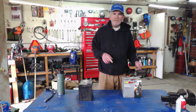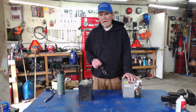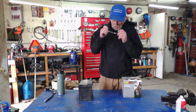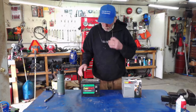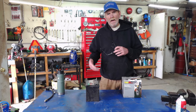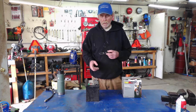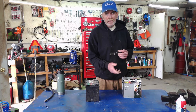Welcome back to the channel. My name is Eric. We do weekday Monday through Friday and that's available on podcast as well. We try to do some educational videos like we're doing today. Today we're going to talk about batteries, and the thing you have to keep in mind is the cold cranking amps. You need to know what your lawnmower takes to get adequate crank on your engine. The bigger the engine, the more cranking amps you want so you can turn it over. If you don't, it'll start getting hot on the post because you don't have enough juice to spin it the way it should.